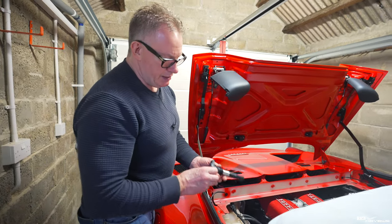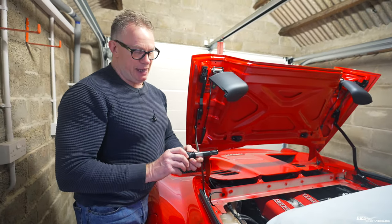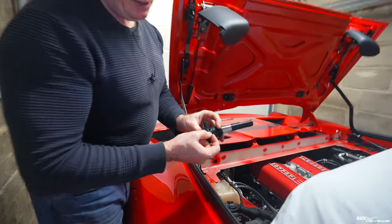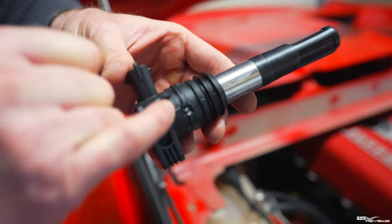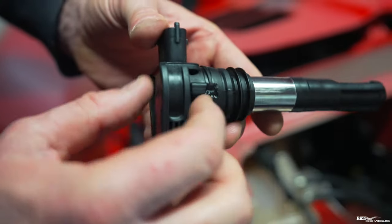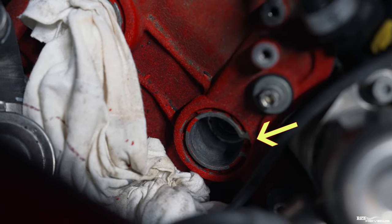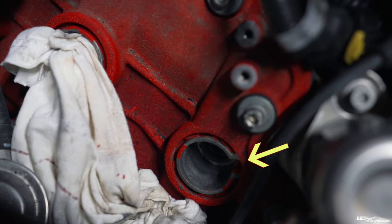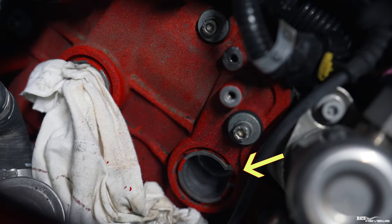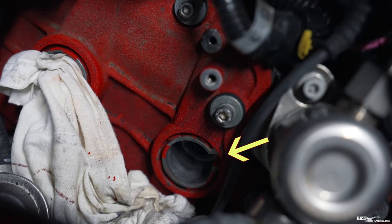On the 458 and onwards they've decided to use this sealing approach without a separate retainer bolt, and it was absolute hell getting them out on a spider. This protruding part — a lug, or 'key' in engineering terms — locates into a slot in the engine port. You can see the key slot on the right-hand side; that's where the coil pack locates. When fitting, you push the coil pack in and swivel it so the key locates into the slot.